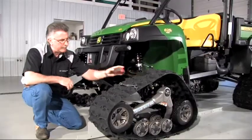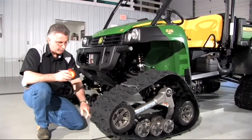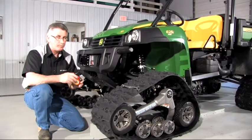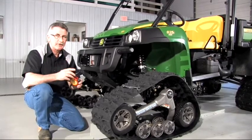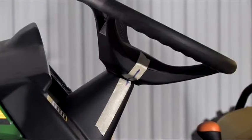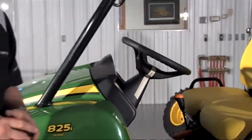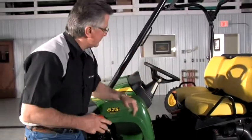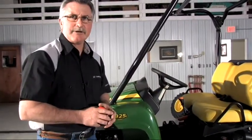We'll now take measurements with the ruler between the straight edge and the outside wheel, but before doing so we have to go back and look at our steering wheel location. We want to confirm the steering wheel location from when we marked it earlier. Make sure your mark is lined up — this is critical in the front end track alignment.